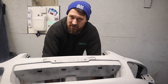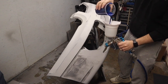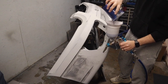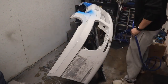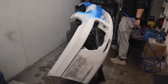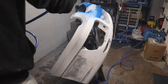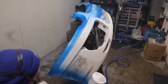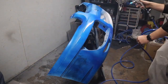I'm excited about this to see how it turns out. So I've mixed up around 250ml worth of base coat, which with the paint that I've got is 125ml of the paint and 125ml of base coat thinners. I'm not a professional painter or anything like that. This is all purely in a garage, DIY style. So please don't come on and give me hate for just doing a wee DIY project. This isn't professional. I don't get paid for any of this sort of stuff. I'm just trying to learn as I go. And as you'll see coming up, there's some pretty big mistakes coming.